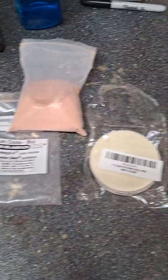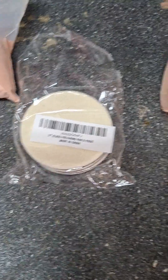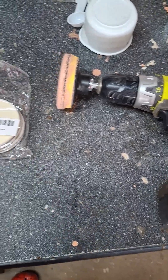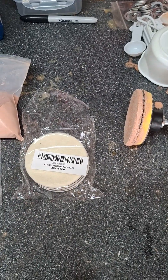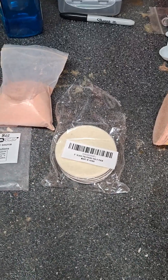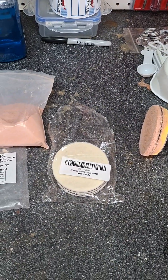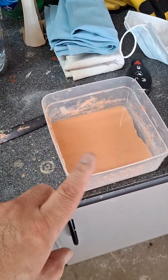I'm using cerium oxide and a three-inch glass polishing pad and a wireless drill to polish my rear windshield to remove streaks from damage caused by running a dry wiper on the glass. It does work. You need two parts water and one part cerium oxide — mix it into a paste and it goes a long way.